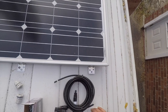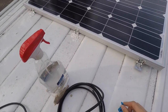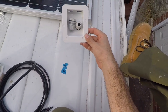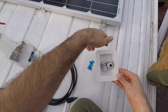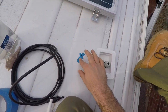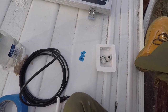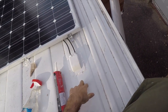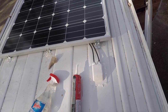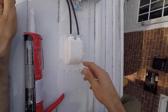Now I'm just going to drill the holes for this, run the cables through, and leave these up — it's not supposed to rain tonight and I'll be able to finish everything tomorrow. Got my two holes drilled that I'm going to run my cables through. I'm just going to use this Sikaflex around the edge of this piece and put it through. I didn't put a grommet in but I sanded the edges down — they're pretty small so these fit pretty tight and I don't imagine there's going to be a lot of wiggle room for the roof to cut the cables. I've got this piece here with cables running through it to the body.